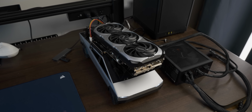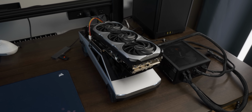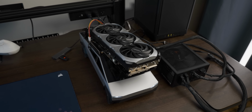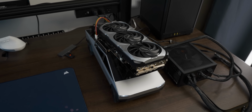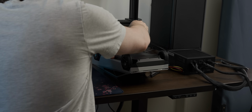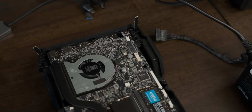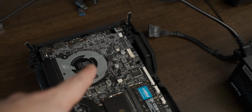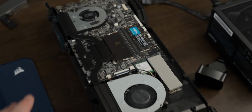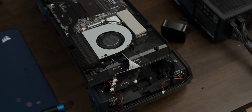So now that we've seen the kind of devastation wrought to a system's performance by using a Wi-Fi card slot, even a modern one, to plug a graphics card into it, let's have a look at an Oculink setup. The first step was to tear the Mini PC down for the 17th time today to reveal both its succulent M.2 slots. And just like that, we've got easy access to our second M.2 slot, and the system is more or less still fully assembled.